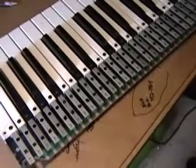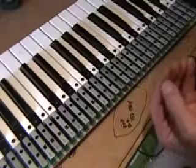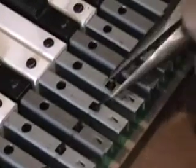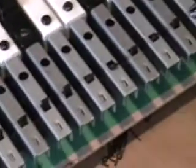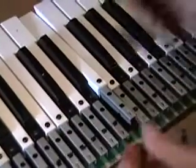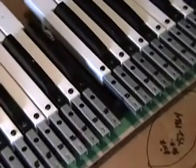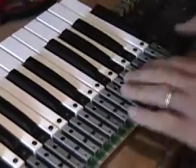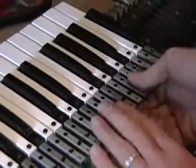To make a note about removing the keys: you might find some more difficult than others. Note that the back comb of the key — a lot of these are bent. What you want to do is bend them straight. This will help you get the key off easier and also put the key back on easier. But be very careful that you don't break the metal, so move it slow. As long as they're relatively straight, they come off easier, though a lot of them are difficult to pop off.